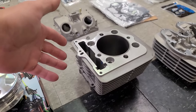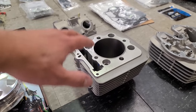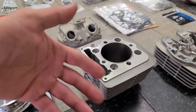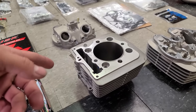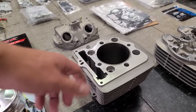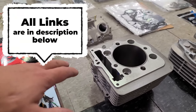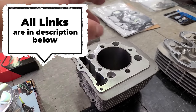I felt like it was more cost effective to use a no-name brand cylinder. So I ran this in the 400EX build, the 416. We beat the crap out of that thing. I sold it to a subscriber. He's been beating the crap out of it and still I don't think he's had any issues with it. So I just don't see a problem running one of these. It's more cost effective and it was way quicker than fixing the OEM one. So that's what we're going with. It is the 88 millimeter to match the JE piston.